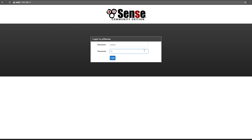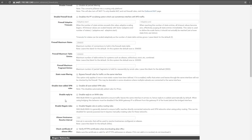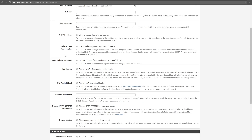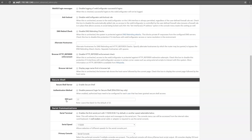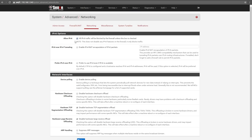You can go to the IP address of the router in your web browser, and you've got an easy-to-use web configuration GUI just like a traditional consumer router. This is where you can install plugins, tweak settings, and do anything more advanced. The first thing you want to do is set a password - once you've set a password, that will help really secure the device. You can enable SSH if you're familiar with it. SSH is a remote control, remote Unix administration interface that's been around since the dawn of time - it's its own deep subject, but the SSH service is available and you can turn it on if you want to.